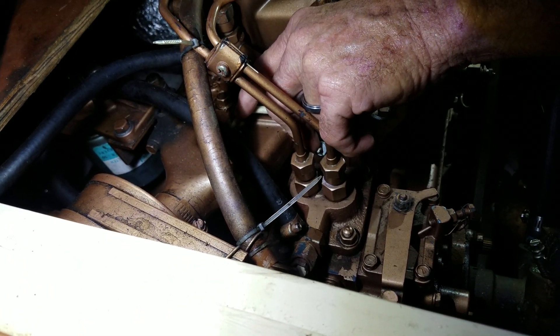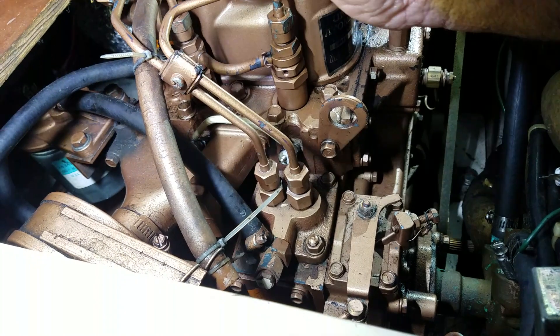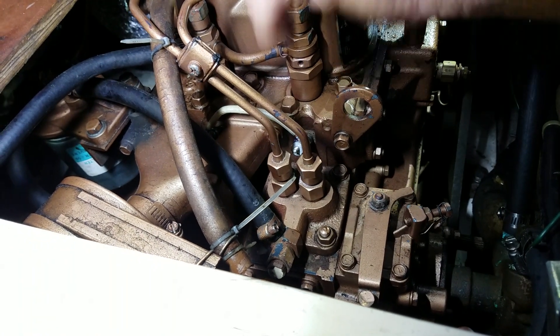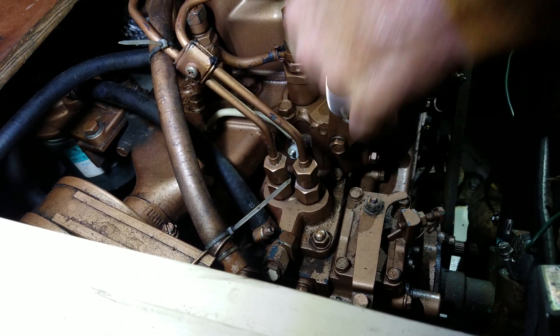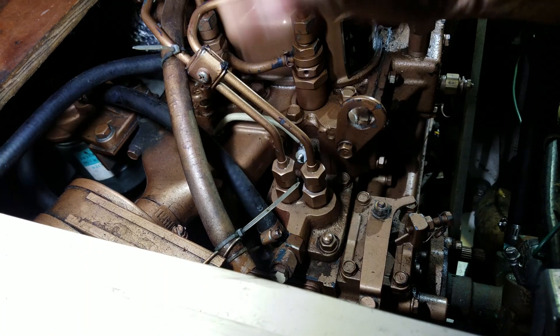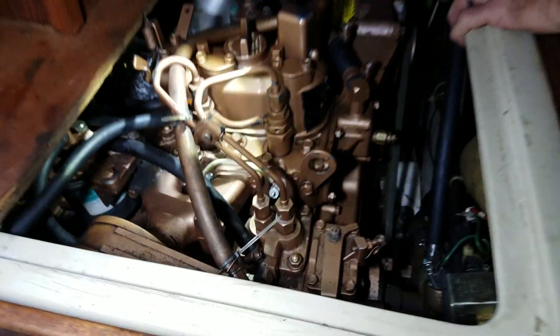It's a pretty good draw when you're in glow plug mode. Normally in this climate you can get by without them, but if you want a quick cold start, you just pull the glow plug down. Jim showed me where to press before starting. With the temperatures we've been having, it'll usually start without them. Some engines are more finicky than others. These look like they've been replaced at some point — see how they're new and not painted with the engine?